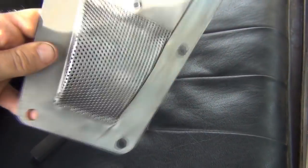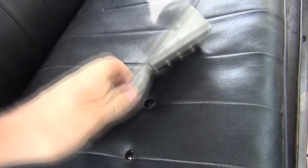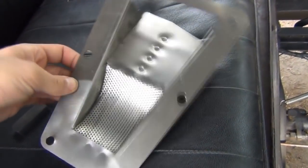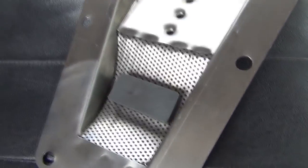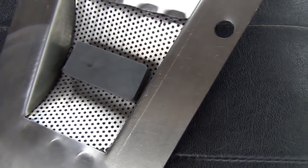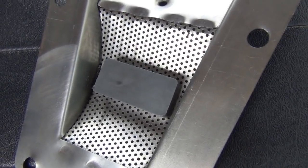This is the oil screen - I've now given it a thorough clean, degreased it, and got rid of all the metal filings and fluff. It's made of stainless steel so it won't rust - I was able to hit it with degreaser, wash it in soap and water, and thoroughly dry it. It's nice and clean now, ready to go back in the car. I've also cleaned the magnet - that's just a simple bar magnet that sits in the screen and catches any iron filings that might build up in the gearbox. The screen itself catches fluff from the transmission bands.